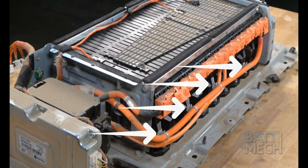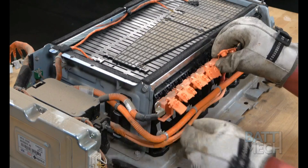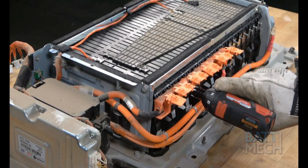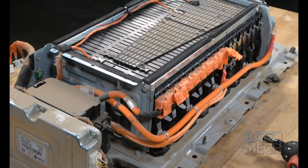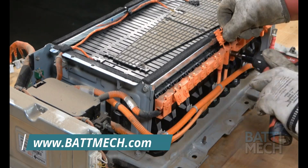Also, be sure that you have clipped the wire harness back in and onto the battery modules as shown. After you've secured the wires to the bar with a zip tie, move to the other side of the battery pack and attach the wiring harness to the modules using the nuts. When attaching the orange wiring harness, it will re-energize the battery — be sure to have on the proper PPE.